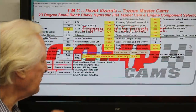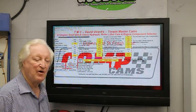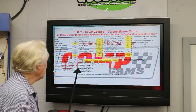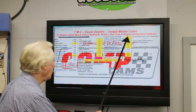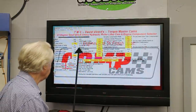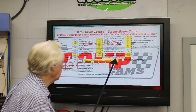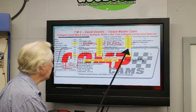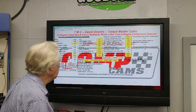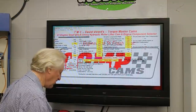Let's see what that will do if we convert to a roller setup — that's a lot more money. On the hydraulic roller page, because the cam lifts more slowly off the seat, it tends to generate higher dynamic pressures. So to get the same dynamic compression ratio, we put the peak power RPM up to 5,250, which is realistic for the comparison between the two cams. We've got 448 foot-pounds of torque and 412 horsepower — a little bit more, due to the roller going further up the RPM range, that extra 100 RPM.